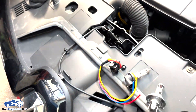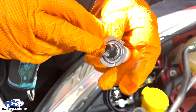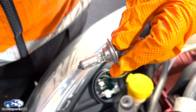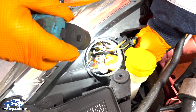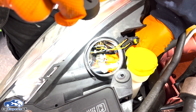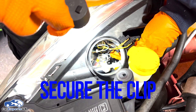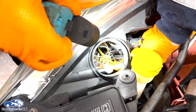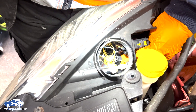So we're going to get a H7 bulb, which is this. The tab is at the top — it should locate in the groove. You can see what bit was missing of the bulb now. Don't touch the glass. Get the new bulb with the tab at the top. Make sure it's sitting straight, not on an angle. So we've got to sit it in properly. Bring the gate back, push that clip on to the sides of the clip. Put the plug back in and slowly push the plug on. And that's that one in.